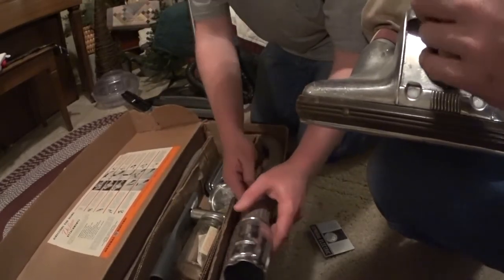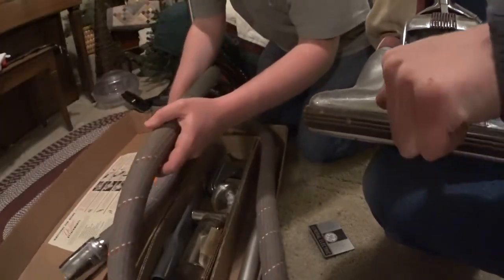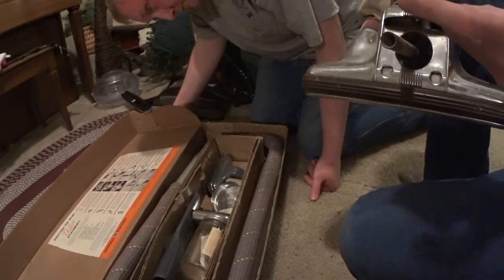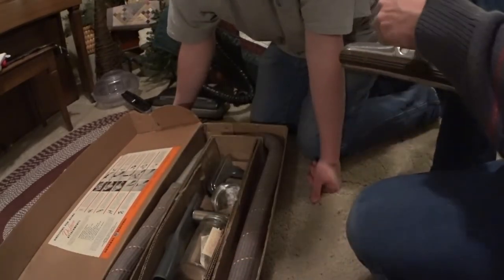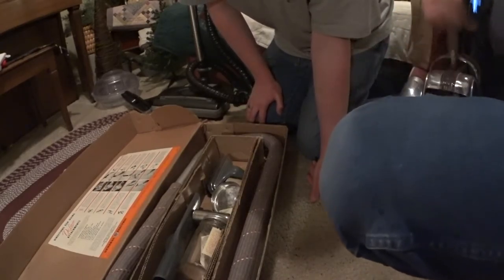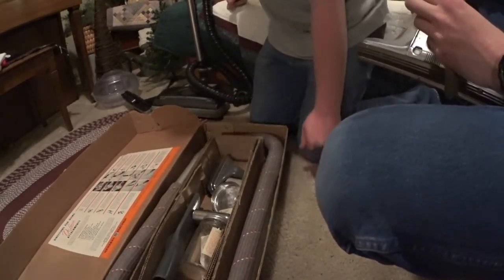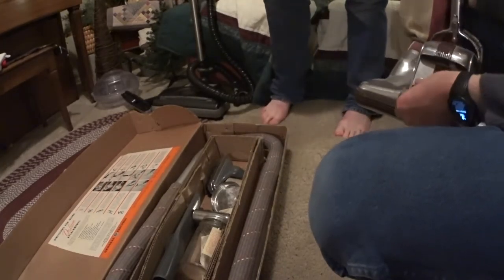So we're going to go ahead and put this belt lifter on. This goes over this. Because I'm not familiar with this machine, let's make sure I'm doing this the right way. The picture actually doesn't tell you which way. I'm going to zoom in — it's the same way as a Royal or a Kirby. So we're going to grab the belt from the bag side — that's the way to remember. That's just very pleasing.